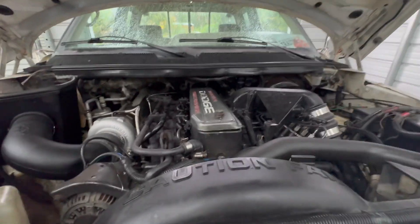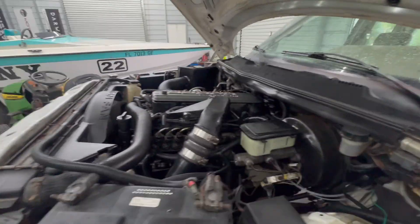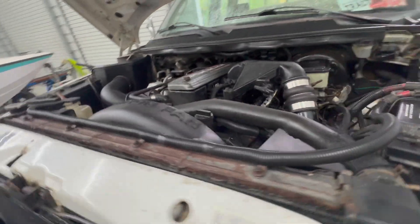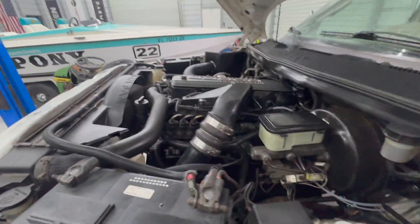These being in at 125 foot-pounds — I feel better about that. We should have more clamping power now, just to make sure we don't lose that stock head gasket at the boost level we're at. We're running 40 pounds of boost and I just want to leave it there. Injectors are probably the last thing. I also went ahead and put a different spring in the AFC in order to get full travel.